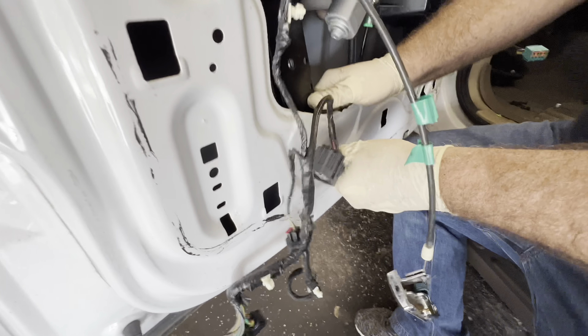Plug the rest of your harness back into place, plug that back together. That goes on the window motor — if you hear a click it's in. Now reconnect the battery, bring the door panel over and connect the switch so we can bring the mechanism up to the glass and put the glass into place. We're using the door panel switch to bring the guides up in place of the window guides.